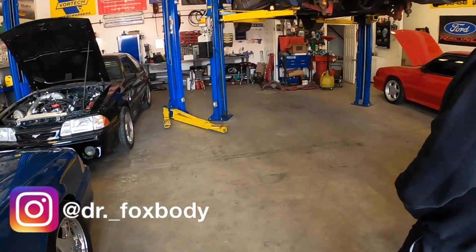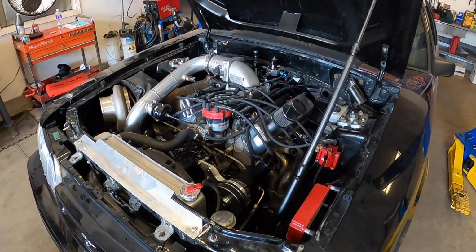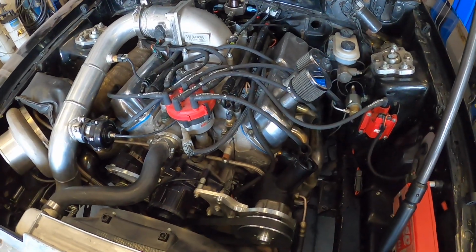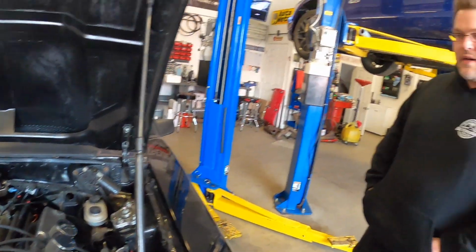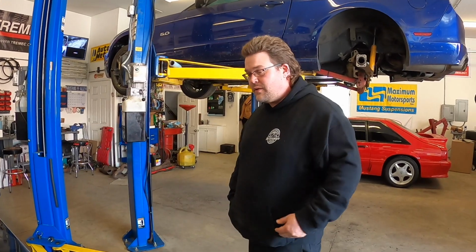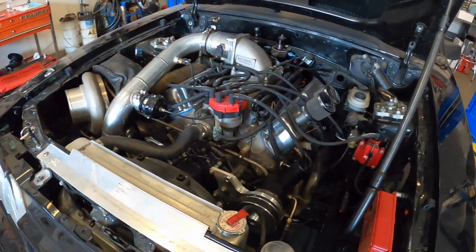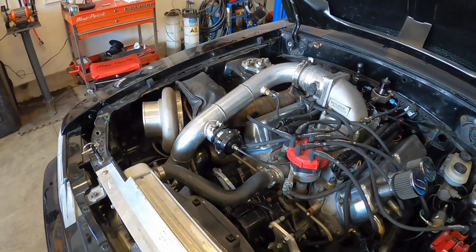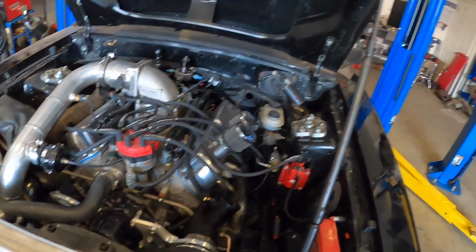Nate, what's up? Hi, Tom. We got slim pickings here today. Now, let's take a look at this race car over here. What is going on with this thing? This is a nice little street car, aftermarket block, Turbo 400 trans. We're gonna check the cam profile and probably change that out. He's looking for a 4-digit rear wheel horsepower. So quite a few things are gonna be changed on this one, including the entire turbo kit. He's even looking at possibly changing the heads, a different intake, obviously the ignition system. He still has stock TFI with a blaster coil on it. That's not gonna fly for what he's looking for. So we're gonna dig into this, reevaluate, and talk to the powers that be, and see if we can get this guy's goals met.